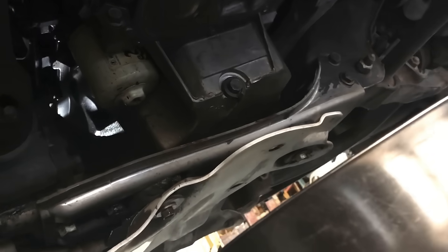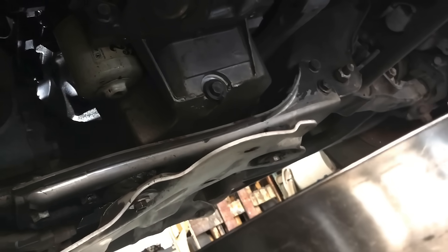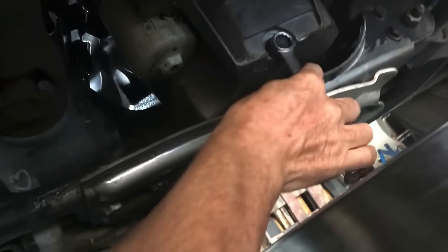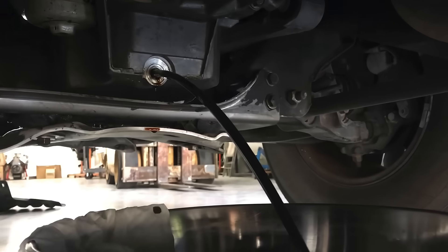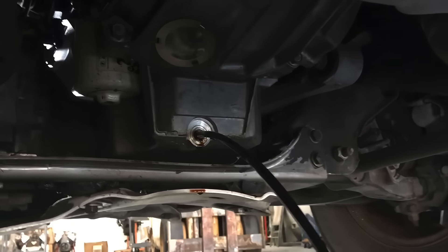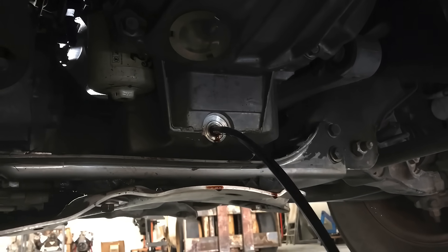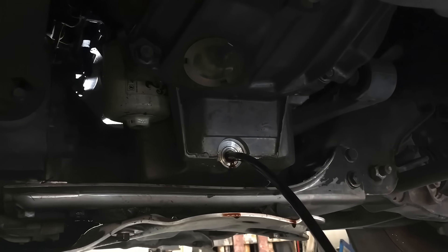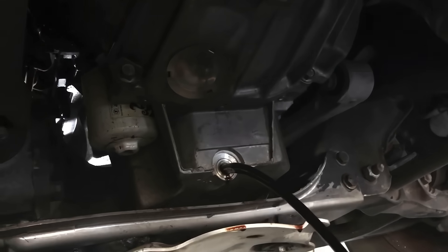Now we're going to try a last-ditch effort — change the oil and maybe put a little stabilizer in it, see how that helps. We'll take it for a ride and see what the oil pressure does. We'll also get a chance to look at the oil and see if there's any bearing material or anything weird in there. The next step if this doesn't work might be to take it apart, change the pump, and check the o-ring. It could be lifters — lots of stuff — but we'll find out.